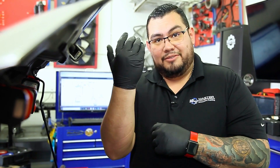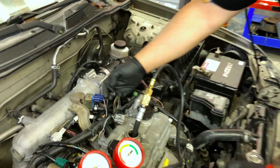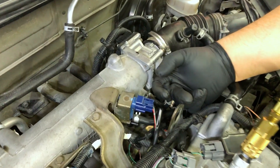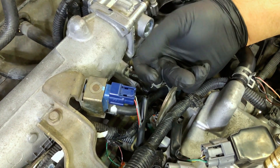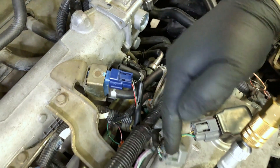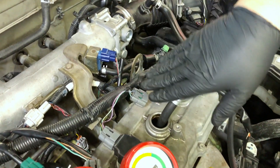Another step — I learned this from one of our instructors — is using a glove. If you take a glove and slide it over the exhaust and the glove inflates, that's telling you that you have an exhaust valve that's staying stuck open. The other one would be to remove the air intake boot or a vacuum hose in order to hear if you have air loss through an intake valve. What we did is remove this vacuum hose right here, and the moment I put my finger over it you can hear a change in noise — this is telling us that the intake valve on cylinder number three is open and allowing the pressure I'm putting into number three to go into the intake.